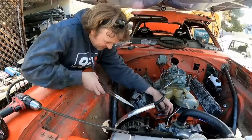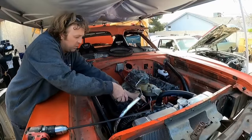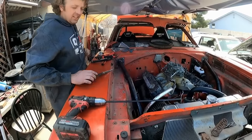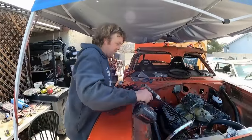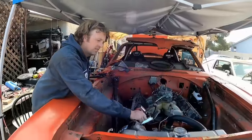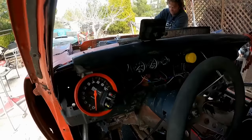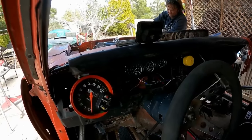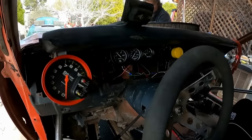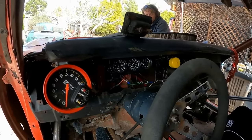So fix that. Now let's pull this distributor drive gear out, because this also drives the oil pump, but we can't drive the oil pump if this doohickey's in the way. So we'll pull this guy out of the way. All right, and we shove this in the hole. And I forgot, which way is it spin? Oh yeah. So Derek, why don't you watch that oil pressure gauge for me? Nothing? Nothing. Oh, there it goes. I see it now. What do we got? About 80 pounds. Yeah. Okay, we're good.